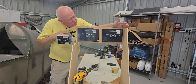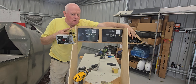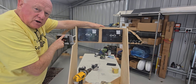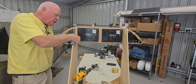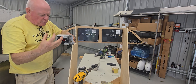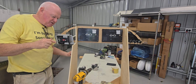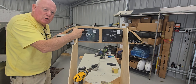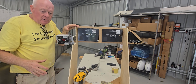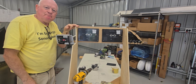When I say this is to scale, this is an exact replica of the actual dash template to get it all positioned right. So when we get to all of these switches at the back — I'm yet to put this side in — the electronic circuit breaker is exactly like this. You may recall I had it set up so that if I remove these two MS screws underneath, the whole lot can fold down. This side will be facing the passenger side, so if anything goes wrong I'll have enough slack in the looms for it to come down.